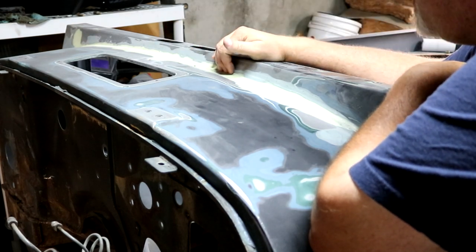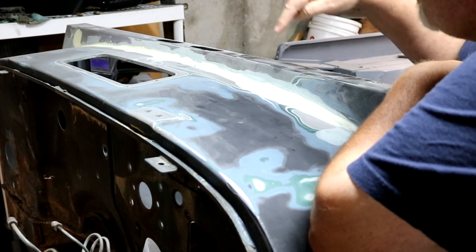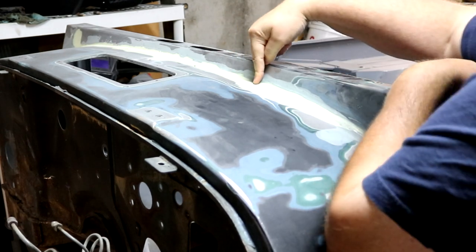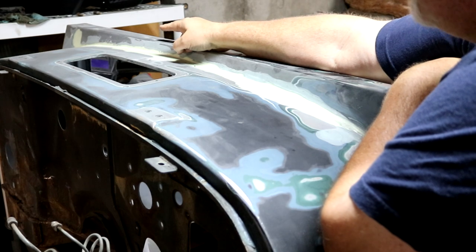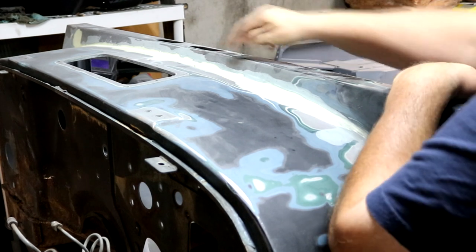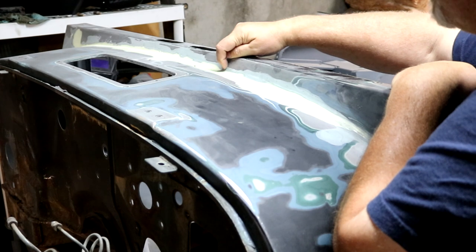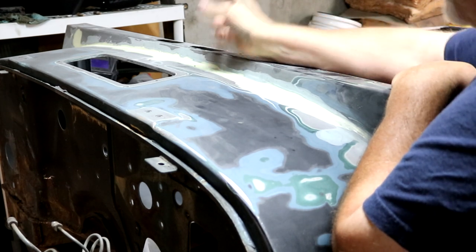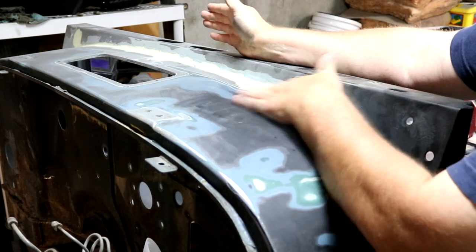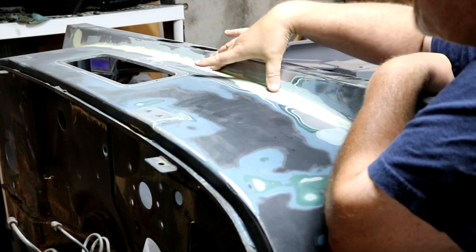So I ended up cutting out about 3/4 of an inch this direction from about here. Quite a ways over there, maybe 12 inches from the other end, about right here it looks like, and 3/4 of an inch this direction, or a 1/4 inch up this column here, and then I took a piece of regular sheet metal and I bent it from here and here. It's not quite 90 degrees, a little bit open from 90. I got a patch piece bent for that.